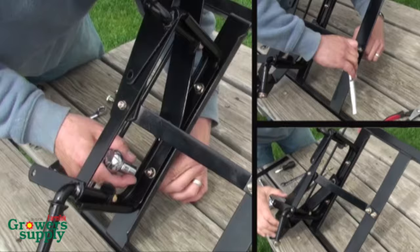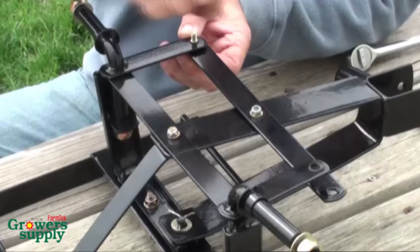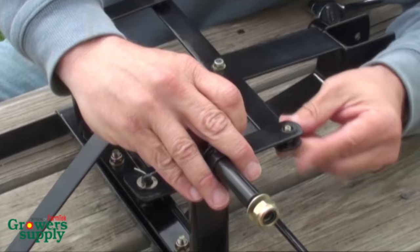Install the axle and axle brace mounting holes — the bolts should be snug. Now take the tie bar, position the ends under the axle ends, align the bolt holes, and install three shoulder bolts, flat washers, and lock nuts. Tighten the bolts until snug. To prevent stripping of the threads, do not over tighten.